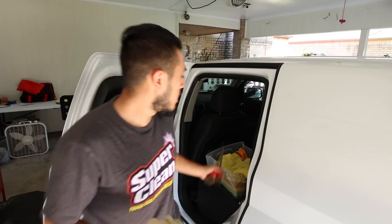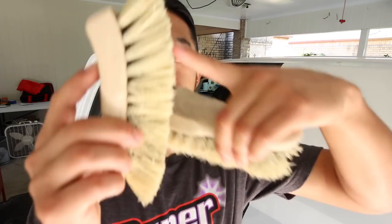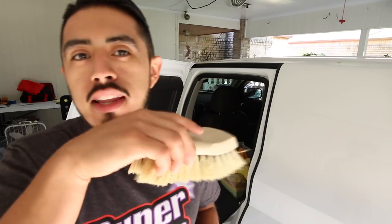Using a small brush on leather does take quite a bit of time. I was hesitant to use this upholstery brush on leather because of how aggressive the bristles are, but once I tried it, it was so much easier — you cover so much more surface area. You don't damage the leather as long as you apply common sense: just gently agitate, don't apply excessive pressure. I've done plenty of leather seats with this brush with no damage at all.